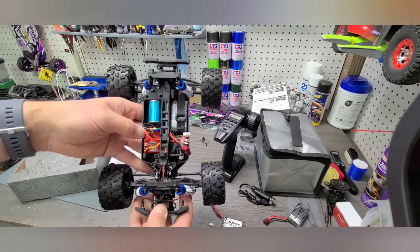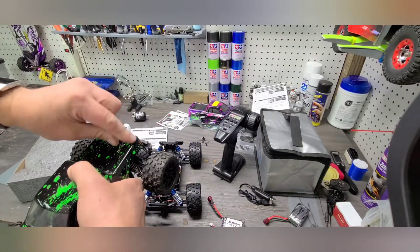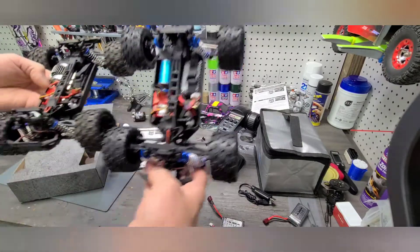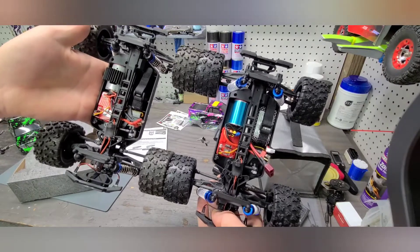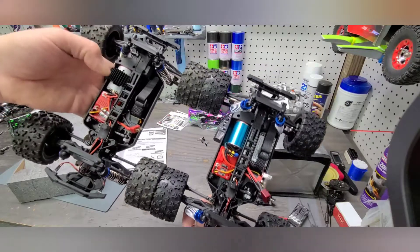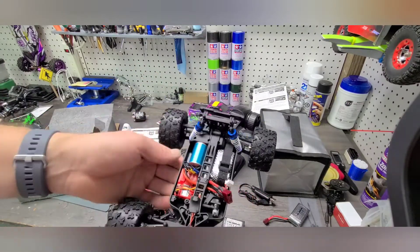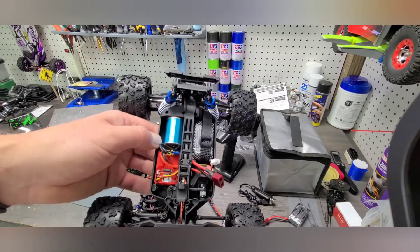Let me pop the other one off so you'll see the differences. The underpinnings are basically the same — the platform itself is very much the same. Where it starts to get a lot different is if you notice the motors. This is the brushed motor with a heat sink on it, and then this is the brushless motor. It's a significant difference in terms of overall performance, drivability, and longevity of the system.